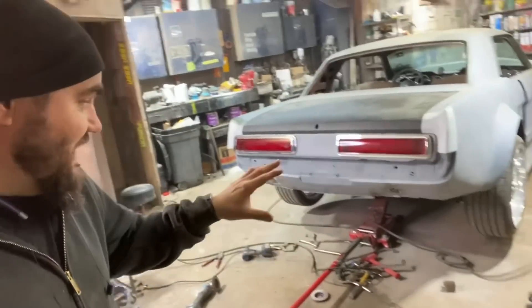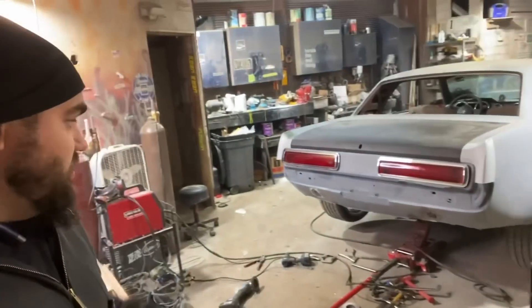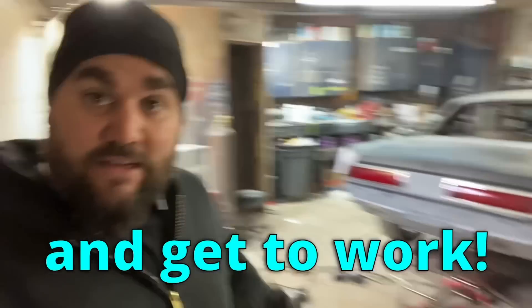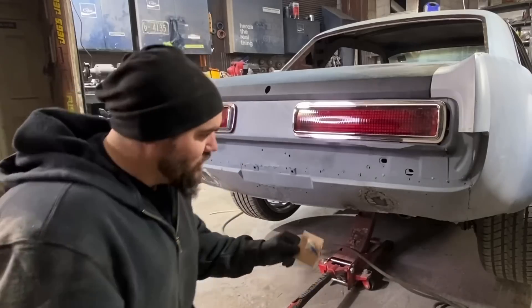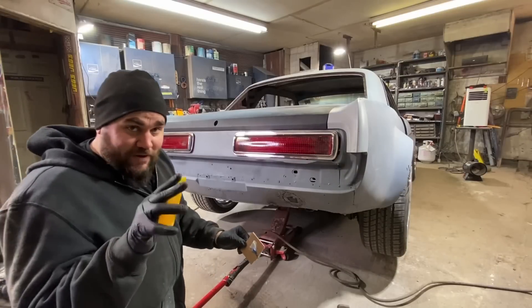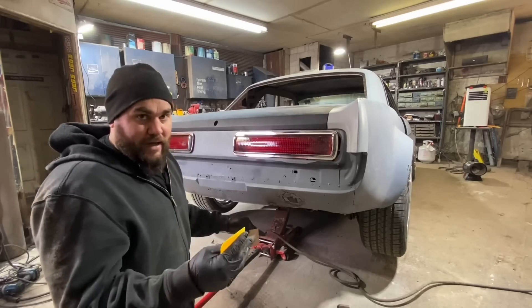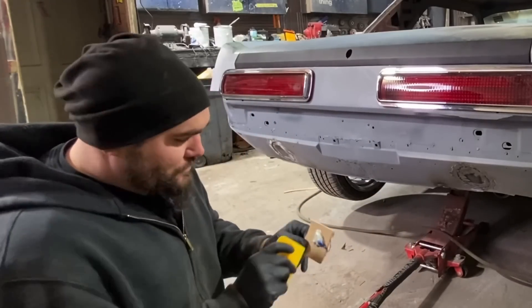The good news is I did get this done - I got it all welded up, got to grind it down. I'm gonna start my body work on it now. We should be able to get the body work done and hopefully get it in primer. Since the metal work is all the way done with this rear valance, it's time to start our body work. This is all the body filler I'm going to need. Some of you guys really need to spend more time making your metal work look good and you don't need to just lather body filler everywhere - this is the only thing I'm going to need to get this cleaned up and then we're going to get it into primer.